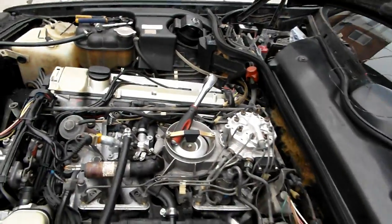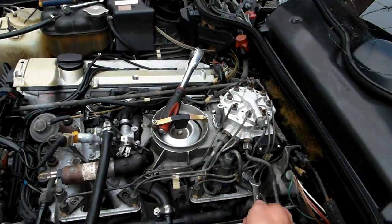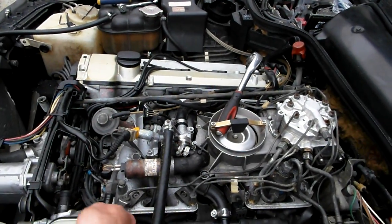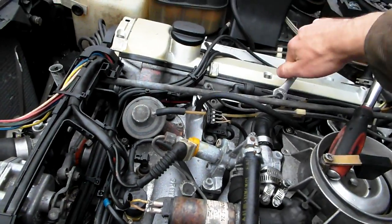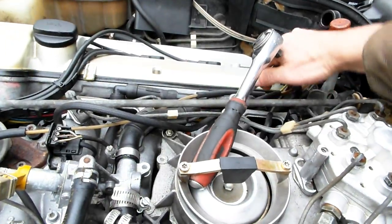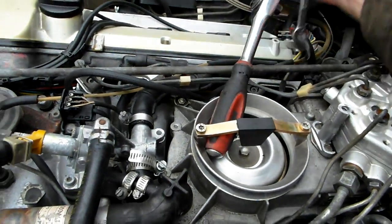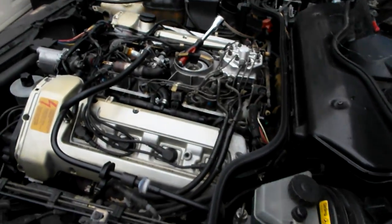There's too much air. I can hear the injectors though, which is really nice. I'm going to put on the fuel pump and get these injectors to actually pump because I'm not getting constant fuel pressure. Let me pause for a second.